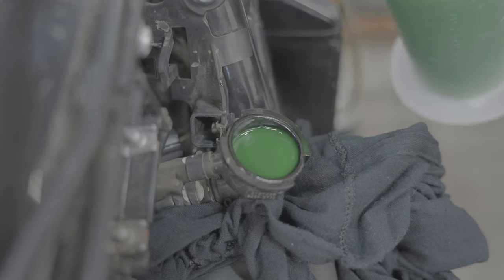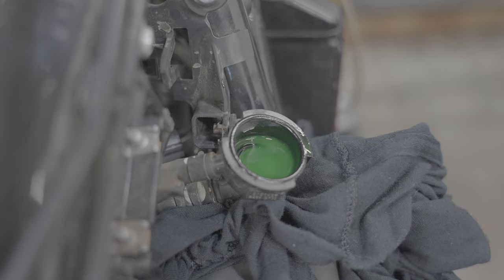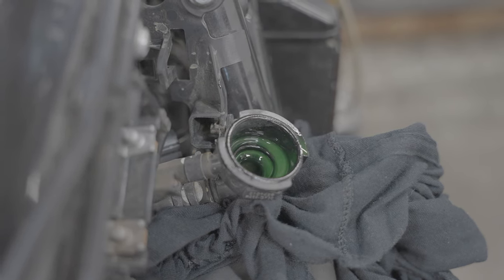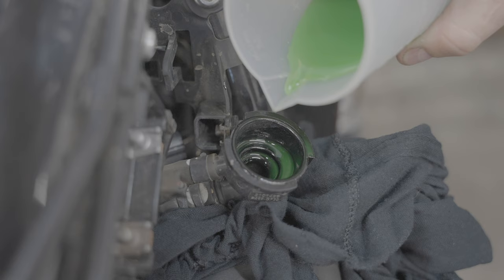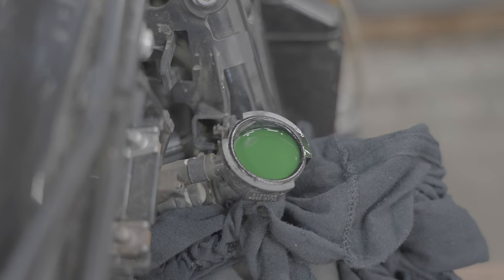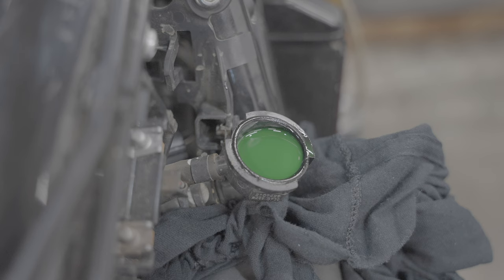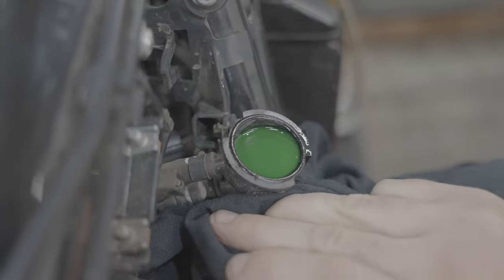There's a link in the description below if you really want to get stuck into the nuts and guts of it. But basically 1.89 liters of an equivalent coolant to top your engine up with - that's how much your coolant needs if you are flushing the entire system. Generally you'll just need little bits topped up here and there, unless you have some issue where the radiator fills up and boils over, in which case I'd recommend doing an entire coolant flush - using water to flush the entire system out and then replacing the coolant.